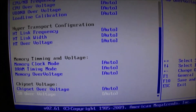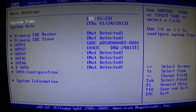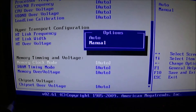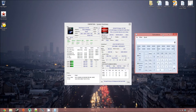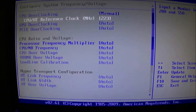This is the rest of the options — many people don't understand this, but that's the way I want it. So I'm gonna save it, the PC restarts, and it's okay. But many people run into problems with the memory, that's why I mentioned it. So you need to put the memory clock a little lower. This is the default and this is now a little bit lower. You're gonna be thinking, hey, what the hell? My RAM is at 1033. Well, that's the way the memory clock is reported — because you multiply it by 2 and you have the true value of the memory. Do you understand?